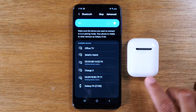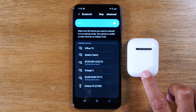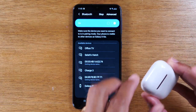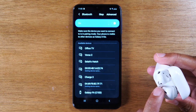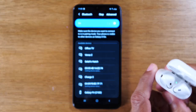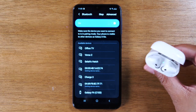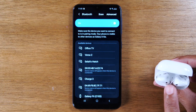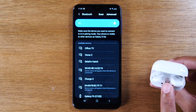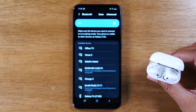Now on the AirPods, there's a little button on the back right at the bottom. You're just going to first open up the AirPods. There's a little indicator light that you're going to see — it's going to be green initially. What you're going to need to do is hold down on that button for about a few seconds. Wait until you see the little icon inside of your AirPods begin to flash white, a little white light. Let's go ahead and hold down on it.